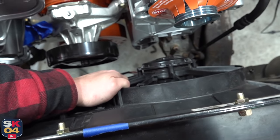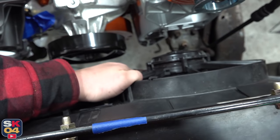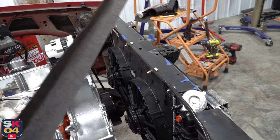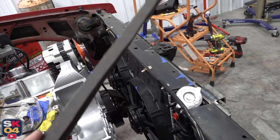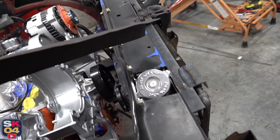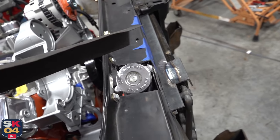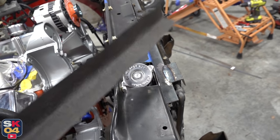Just to reiterate once again, it's important to try to prevent any metal on metal contact because you don't want to wear out a particular component or cause a leak. You also don't want any possibilities of squeaks because metal on metal is going to squeak. So if you have a tight area like right here where the top edge of the radiator support is sitting right underneath the core support, a gas tank insulator strap works wonders.